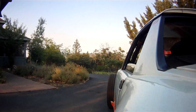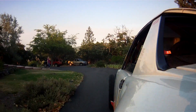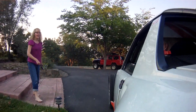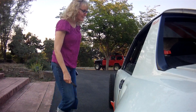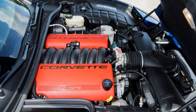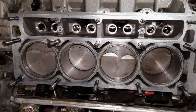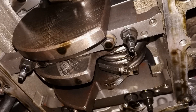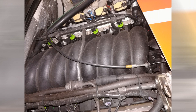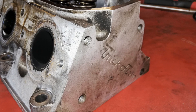When I received the car, I noticed quite a lot of excess valve train noise — mechanical, and definitely something that needed to be addressed prior to driving the car for any period of time. A quick rundown of the engine: original LS6 engines don't have adjustable valves. This is a 2004 LS6 Corvette aluminum block with all aftermarket components — forged crank, rods, pistons, custom cam, Trick Flow heads, and T&D adjustable shaft rockers. I added up about $10,000 in receipts.